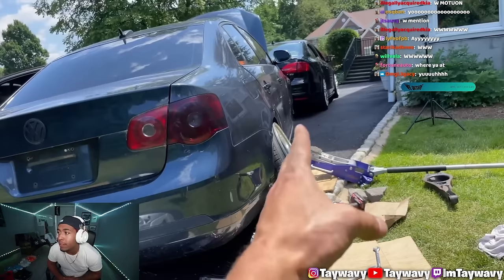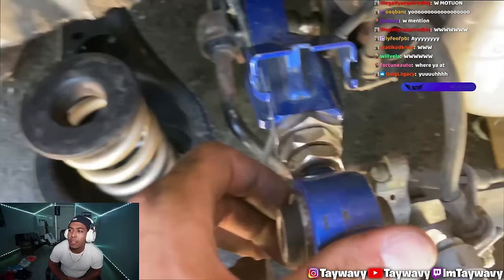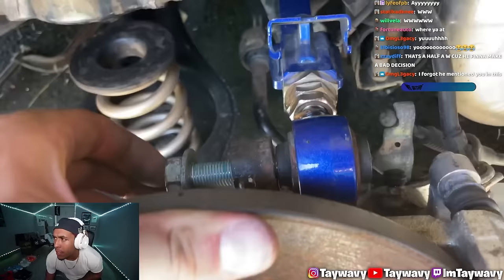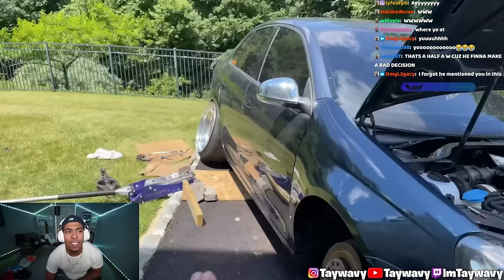There's enough room for me to bring this wheel out and hopefully not hit the fuel filler neck. So I'm going to go ahead and adjust the camber arm more. I brought it out almost a full another half inch. So let's say we adjusted the camber arm a full inch and didn't adjust the bottoms. That's how you properly adjust. I just add washers.